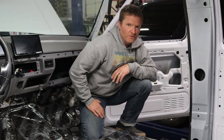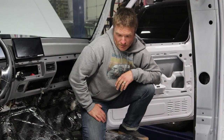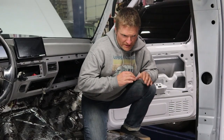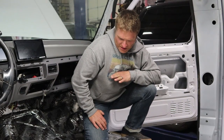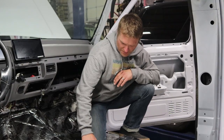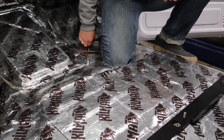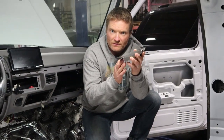The first hurdle was getting our seats as low as possible. How we did that — well, Kenny, are you a cutter or are you a basher? Because that's the question you're going to have to ask yourself. With this kit, we give you a truss for the front, the back, the rear seats, but you have to get that truss as low to the floor as possible. And how we did that is we actually had to pocket this part of the floor, which on our test cab I just took a dead blow hammer and gave it some love. But then I didn't like that — it did the job but it was kind of derpy. So we came up with this little pocketed guy that comes in the kit.